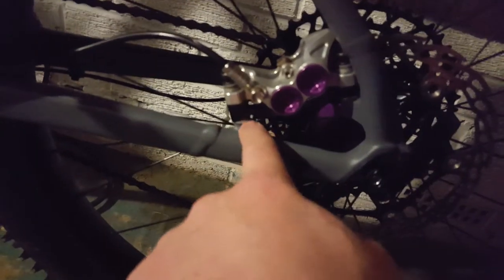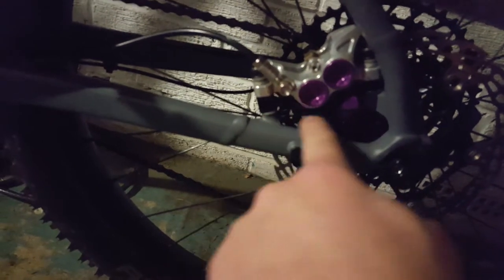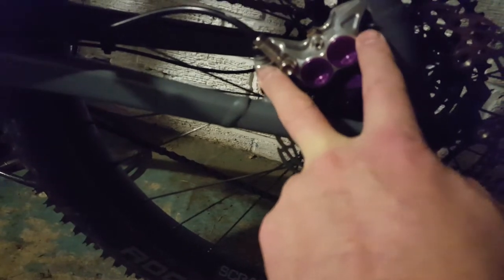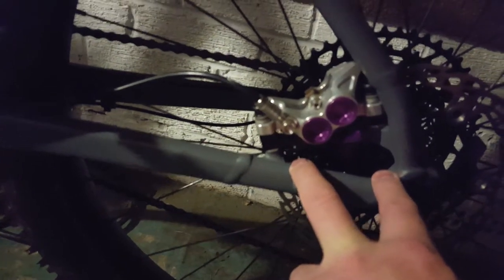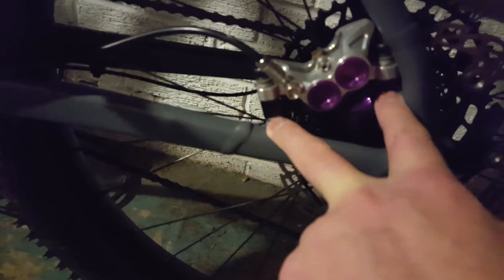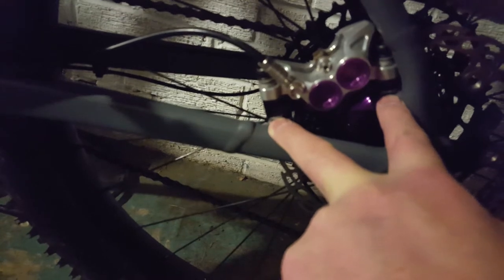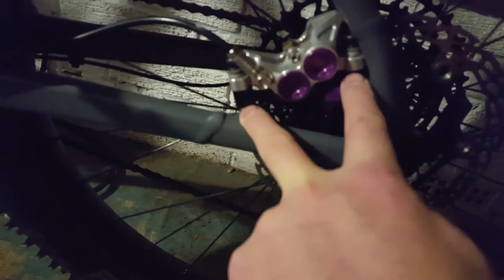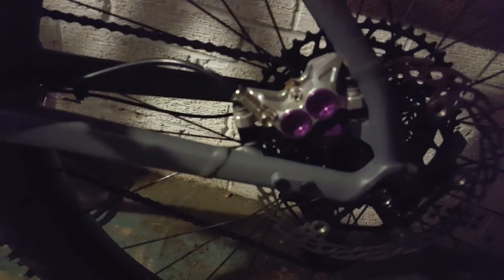Rear caliper, the mounts. Why the hell would you put rear mounts there? Because these calipers, they're really tight to fit, and so apparently are a couple of other model calipers. The Shimano ones are pretty good, but calipers like Hope really, really are tight. I've had to bodge the caliper on — I've had to raise it by putting two washers underneath to raise the actual level so the disc didn't touch the actual caliper itself.